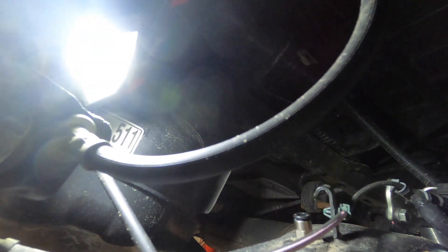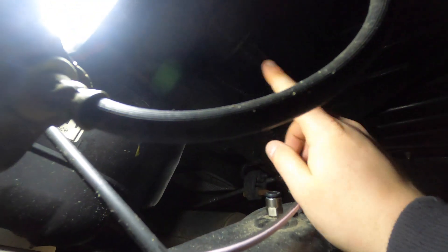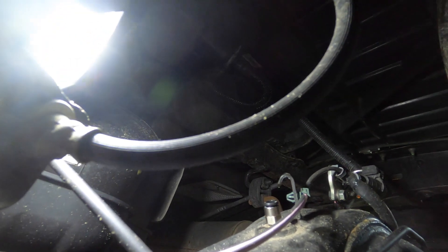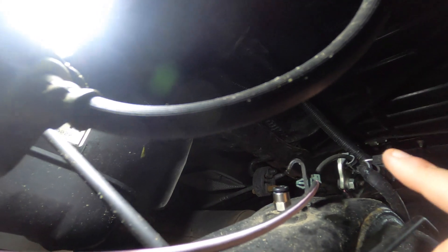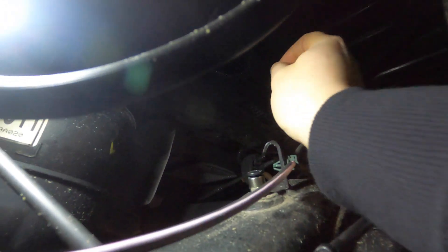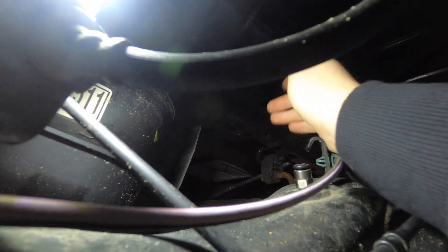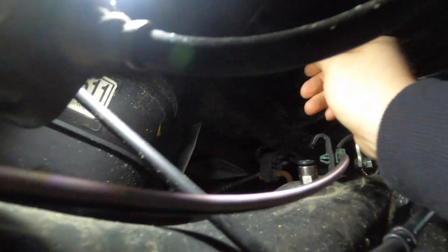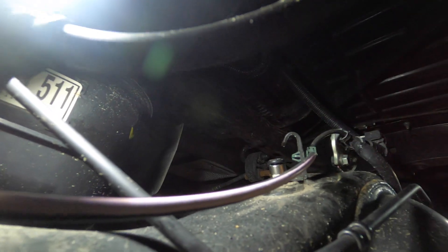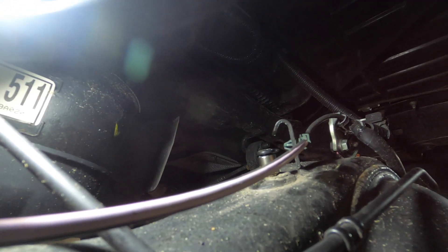I'm going to be routing the line towards the passenger side of the truck. A lot of guys go to the driver's side and mount their filter up in the tail light housing. When you mount your line and put it into the quick disconnect, you want to zip tie some slack up so that when the truck articulates and the suspension droops, it doesn't get stiffened up and snap off. You want the line to have enough travel — just like your brake lines — so it won't break when the rear diff articulates.